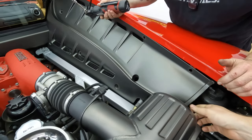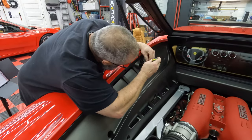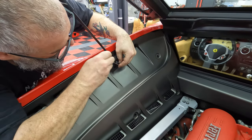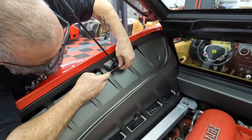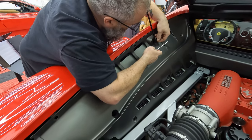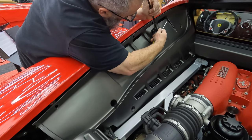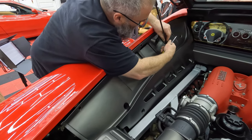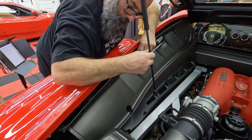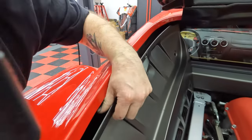Yep. Okay. Now you've got to pop the strut. Screwdriver? Yep. So there should be a little slot, you put it in and... Yep. Does it come off? Yep, the clip will come all the way off, but you don't have to. Okay. You get it that far out. Now, here, you should be able to pop it. Just get a little, yep, okay, I'm holding it. Now get the panel out of the way. Okay. And then we've got to pop that back on, otherwise this will fall. 10-4. Here, I can grab this. There.